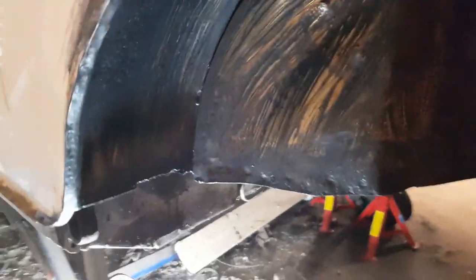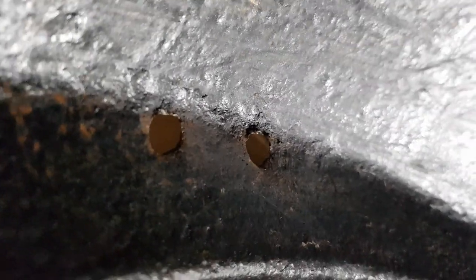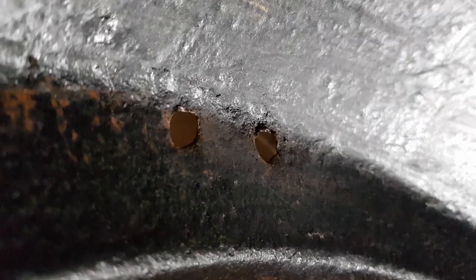Back from lunch and all of that Hydrate 80 has gone off, which is good. I want to tackle these two holes up here. What I did was put a screwdriver through them just to find out where the good metal was — or more accurately, where the bad metal was. They're fine — just two little circular patches needed, with solid metal on either side and a bit in the middle solid too. So I'm just going to make a couple of little patches, put them in from behind, and weld them in.